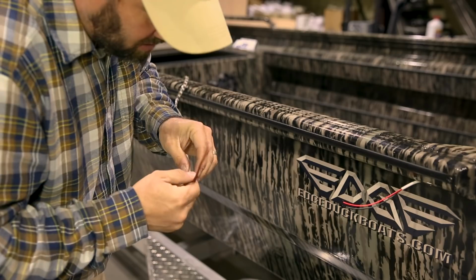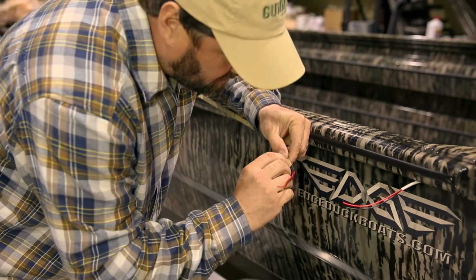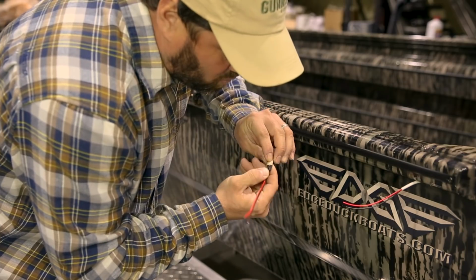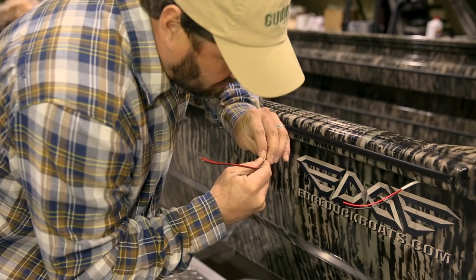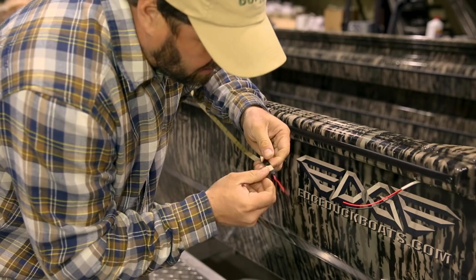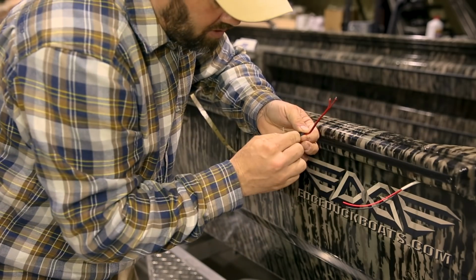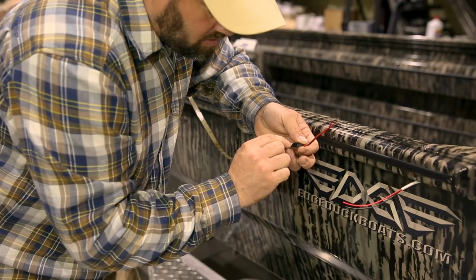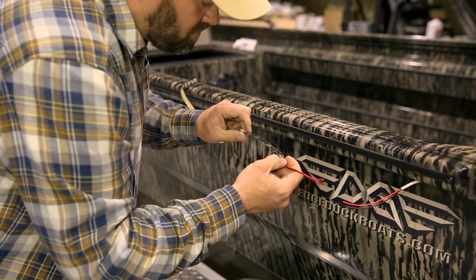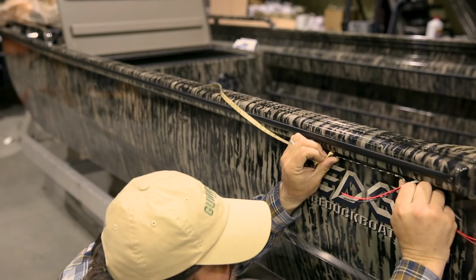We're going to take our snake tube and peel the 3M backing. One trick on this backing: a lot of people will just pull it and rip it. If you actually tear it before the solder joint where we solder the wires and take a section out of it like that, it's easier to start, and then go back to the end and pull that off. Instead of trying to start it right at the end, if you start it more towards the middle of the strip, it's easier to get the backing started. So tear that through. I'm going to peel this back, and we're going to go ahead and stick it to the location that we have cleaned.